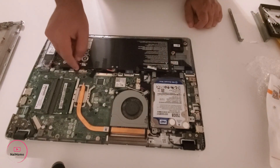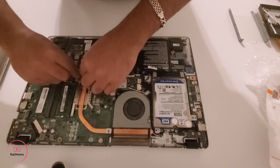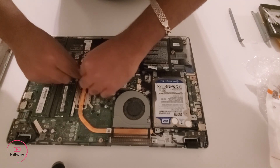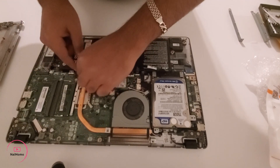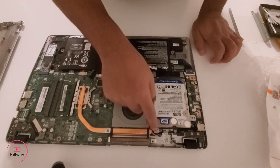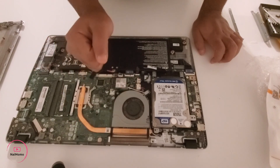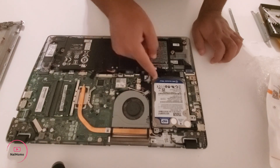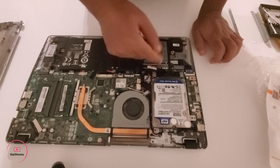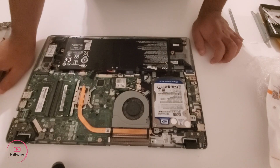The HDD is connected. I just have to reconnect the battery cable that I disconnected earlier. I'm being extra careful here. Okay, that's connected as well. One thing left — I have to put some screws: one here, one here, one here, one here. I don't have them right now and Acer didn't have them either — that's why they gave me the mounting bracket and cable for free. I'll try to find them, but for now I'll put everything back. The HDD should stay in its place and not move once the back cover is installed.